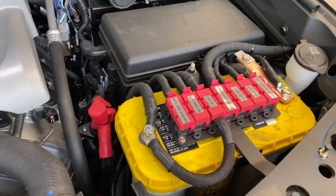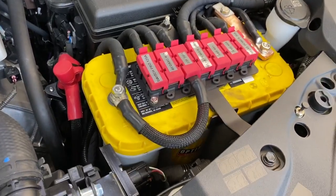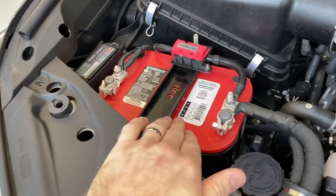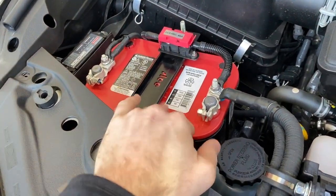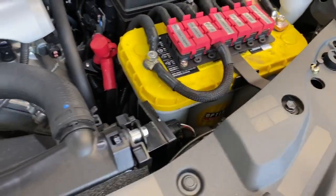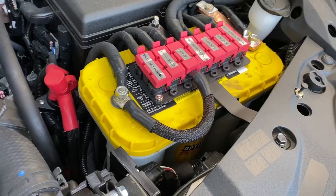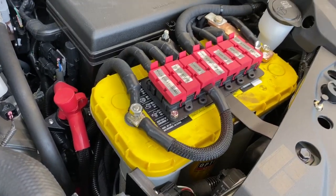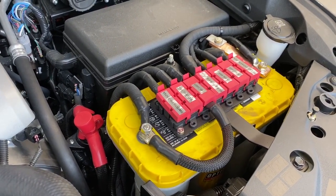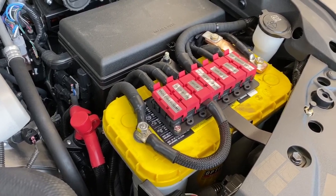There are a lot more electrical modifications we've done on this particular vehicle, but this video is really just to show the difference between having just a small Group 35 auxiliary battery tray located here, depending on what your use case is, or going full bore and relocating the crank battery to the other side so you have a nice massive auxiliary battery for your needs. If you guys have any questions, please feel free to call me anytime. My name is Eric Sargent, Ed Martin Toyota, Noblesville, Indiana.